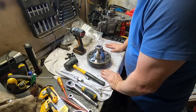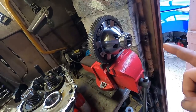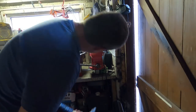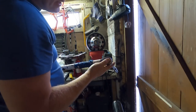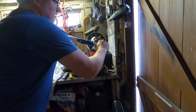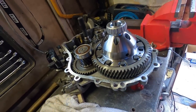Now it's a case of putting it in the vice and torquing to spec. The torque spec is 50 Newton metres, in a cross-star pattern, and after that it's an additional 90 degrees. I'll show you me doing 90 degrees on one of the bolts, because a lot of people struggle with this when they haven't got a vice decent enough to hold it. I'm marking them as I go. I'm using a big ratchet with an extension - I know I haven't got a breaker bar. If I break it, I break it. There we go - 90 degrees, easy.